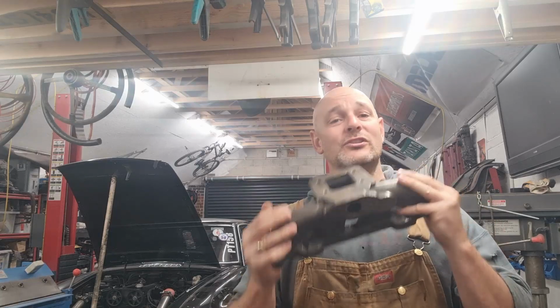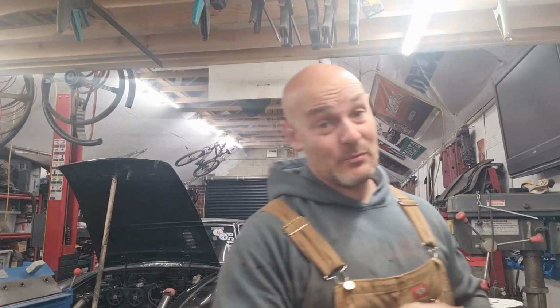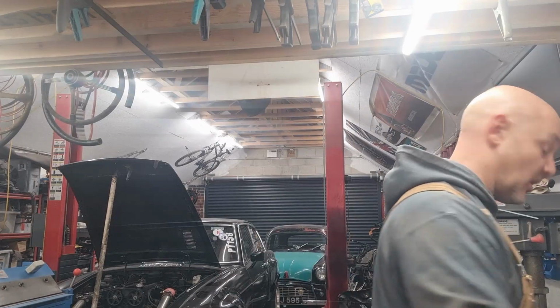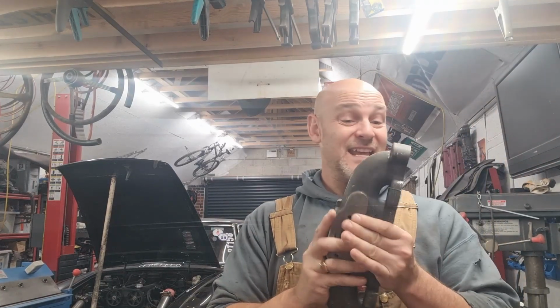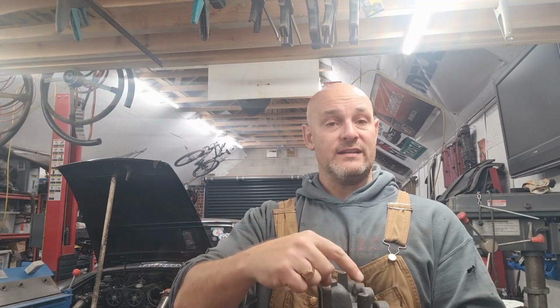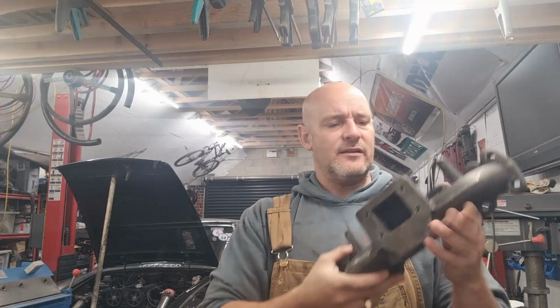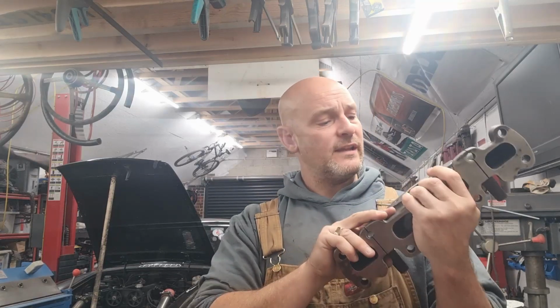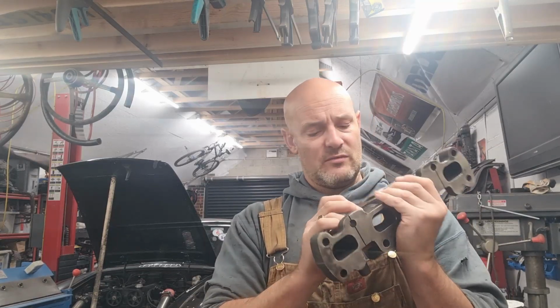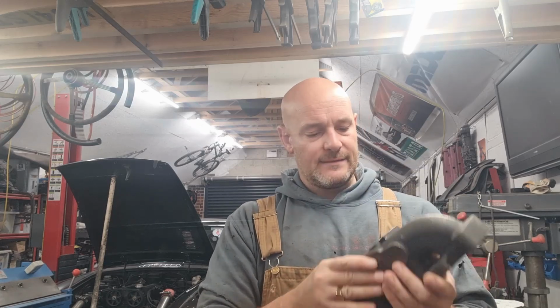Again, because of the constraints of the engine bay, I can't use the typical Kraken type and everything that MX5 people go for. So the thinking is just brace this again. Now, obviously I braced the turbo already, and I can brace the manifold from these 2 points, which is supposed to be for a cover, which I didn't purchase with it. It's got an external wastegate section, but we're going to be making a plate for that and covering that up, because I won't be needing that.